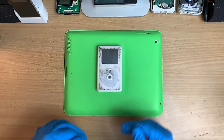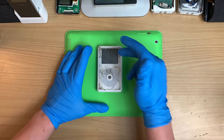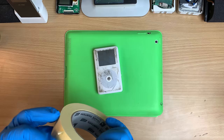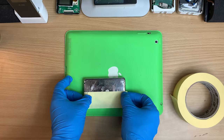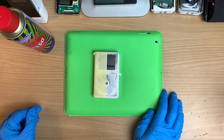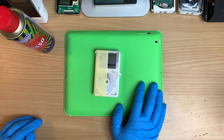Before we start polishing, what even is polishing? Well, effectively, we're removing a layer. Each one of these scratches is just a low point, and what we want to do is take the top surface down to the scratch's lowest point — and effectively, it's gone. So, Brasso, maybe with a million years of going and going, you might be able to get it down there, but we need some help. So we're going to call on household ingredient number two: sandpaper.